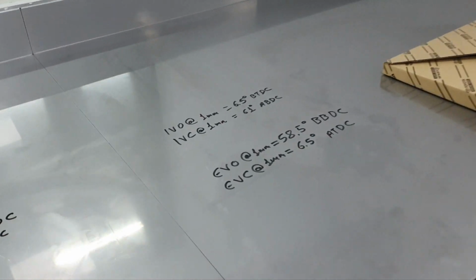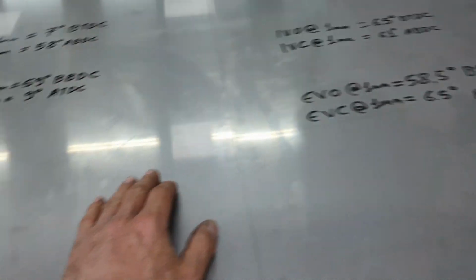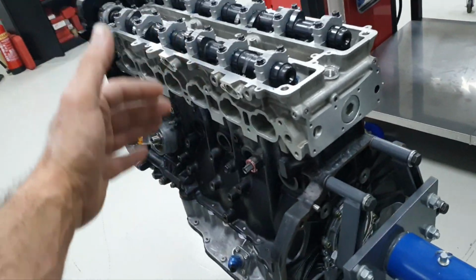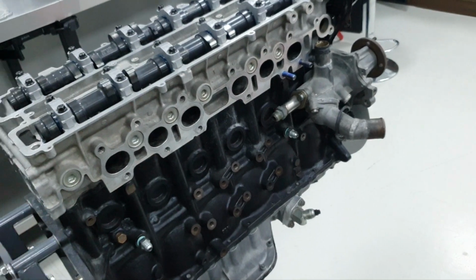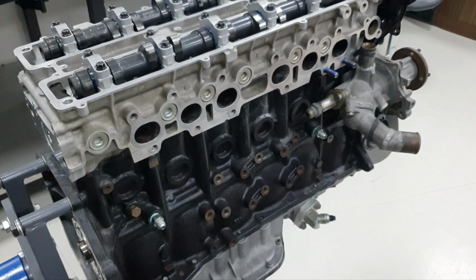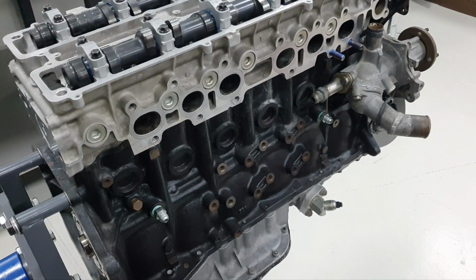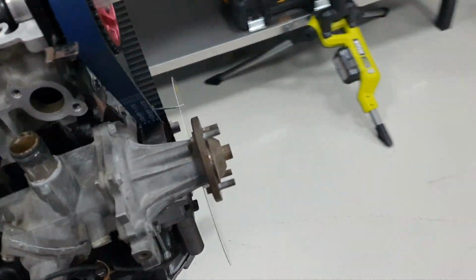Now, my target was to run, and I know some people are not going to like what I did, but trust me, we're going to see on Saturday if the engine survived, if it doesn't crack. Because it has two minor cracks, I hope they stay there. It will definitely seal. For 3 runs, we're going to be fine. We're not going to use 20W-50 oil, we're going to use 10W-40, and we're going to warm up the oil a little bit, so we don't have any headache with the oil pump.